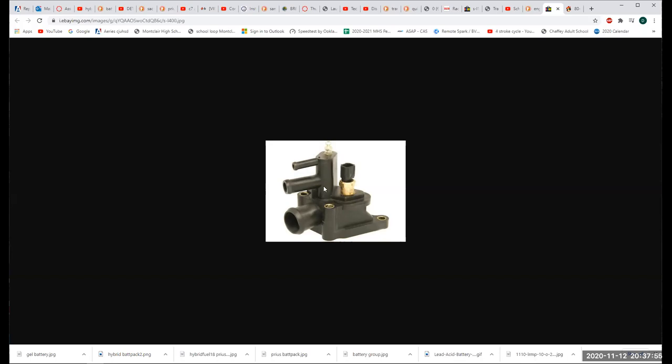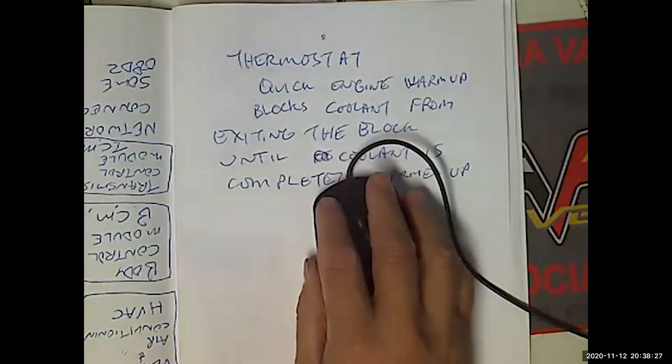Yeah. There's a lot of people that have blown engines by not doing this correctly, changing the thermostat and not bleeding the cooling system. This is why, if you can find a good, honest mechanic, you should probably stick to them like glue, unless you're going to do all this stuff yourself. Because the simple fact of the matter is there's a whole lot of ways to destroy an engine trying to save $15. Yeah, apparently. I mean, there's a lot of ways to destroy an engine, but only one way to maintain it. That's kind of deep.